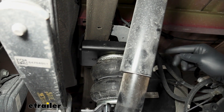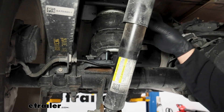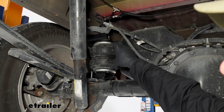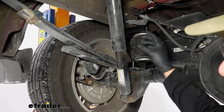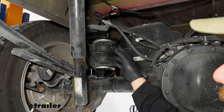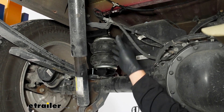It's bolted down to our axle also, and what it's designed to do is take some of the load — it's not going to take all of it. You still want your leaf springs to compress a little bit and your shocks to work as normal, so you can't have them too stiff. But this allows you to adjust the air pressure on the inside to support the load that you're carrying.